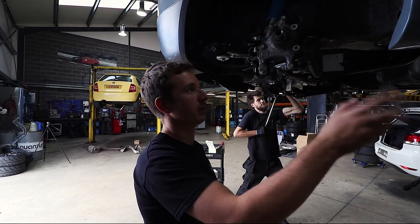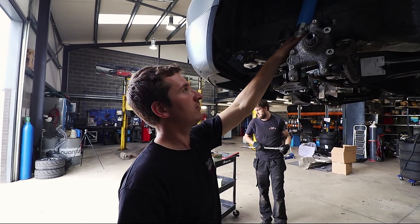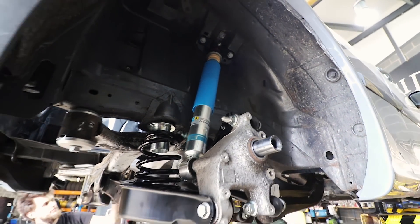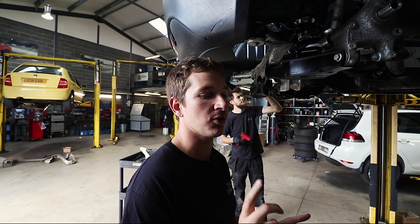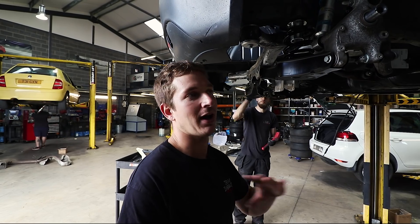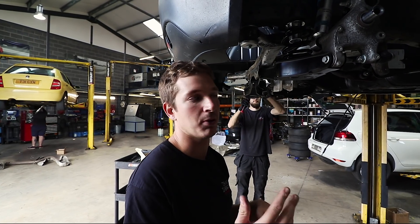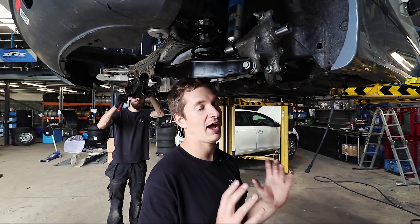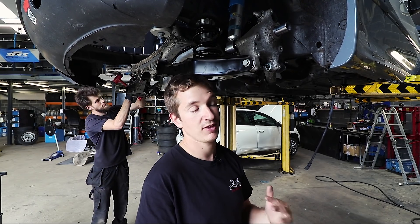It's the arch clearance that's going to be critical, so we're probably going to end up trimming the arches, trimming the fronts. The dampers are all on - these are the Bilstein two-way ones like we've talked about before. I asked Bilstein how to set up two-way adjustable dampers and I kind of didn't agree with what they said. What we're going to do: start with bump at number three. If it's too hard we'll drop to two. We'll probably end up at five or six on the bump and maybe two or three on the rebound. The idea is you go out until it's so hard you can't drive it, back it off a click or two, test it, then start on your rebound - bump first, then rebound.